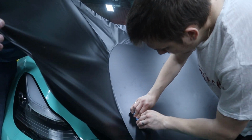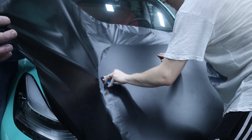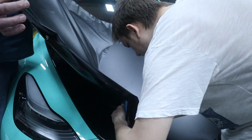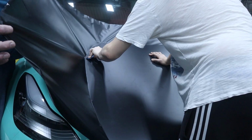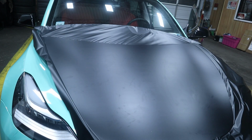I believe we used a little bit of heat gun on the other side because it was already having some marks, and the vinyl just kind of going together in a few places, and also just to fix some of the issues on the vinyl itself. So we just heated it up just a little bit. We didn't do it much, and just laid it flat as well. Hood was easy on the second attempt. The first attempt was just terrible, but if you do it half and half, then it's super easy. I do not recommend doing the whole piece unless you're a professional.